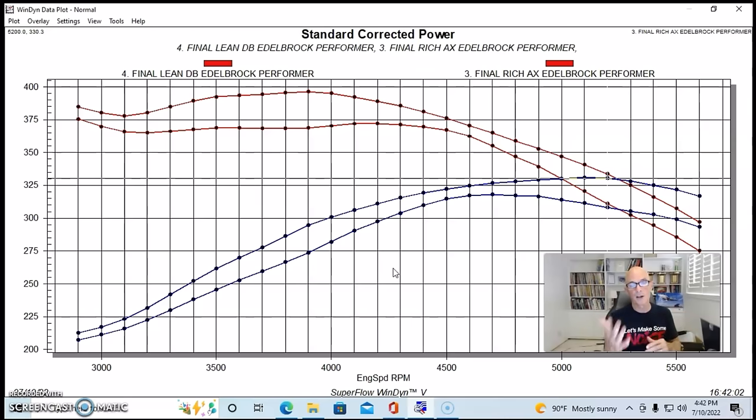One of the other things, or the number of other things that we did to this, to prep this carburetor for this combination to get ready to go in the car, and once it's done and ready to go in, it should work fairly well. Because what we did, obviously, adjusted the metering rod so that we could get enough fuel at wide open throttle, which worked out.